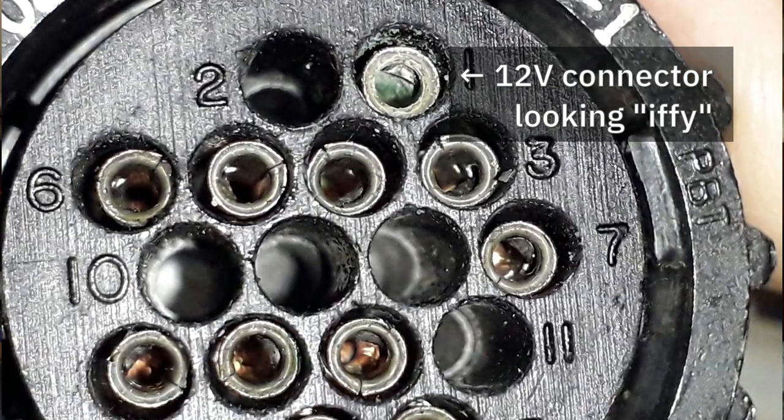Well, it's complete frustration here on Salty Lass, because it was working, it was working, and then we put the sealant on and it's not working. What we've done is used the camera on macro mode on the actual connector that seems to be a bit dodgy. We can actually see corrosion — not really rust, just corrosion — on terminal one, which is the power supply in to the panel. So we're going to clean that, but unfortunately we've got to do that tomorrow because we've got sealant and gloop everywhere. We've got to let that dry so we can scrape it off with a knife.